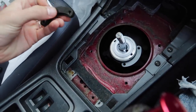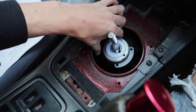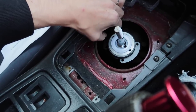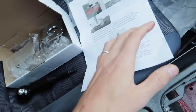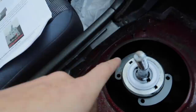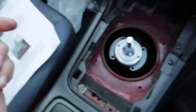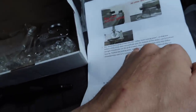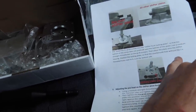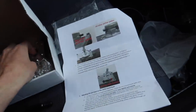I'm actually relatively surprised at how easy this is going. I think I'm not going to have to get under the car at all unless I want to change the springs in the shifter — from the side-to-side kind of motion thing. There's a way you can change how the shifter feels by changing the two springs that go on either side of the shifter. Anyway, now we need to pre-install the four grub screws into the shifter bush locking plate — I think it's talking about this locking plate stuff.